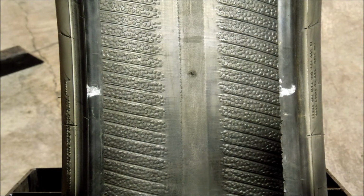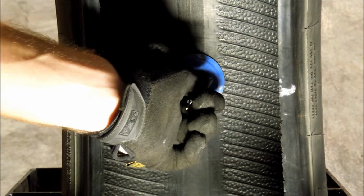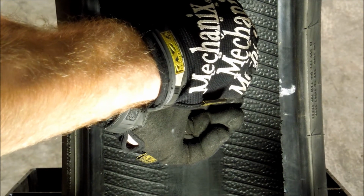Center the repair unit selected over the injury and use the repair unit as a marking template for identifying the buffing area. Trace index lines approximately half of an inch or 12 millimeters larger than the repair unit on all sides.